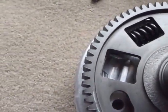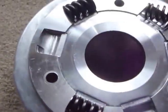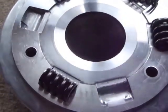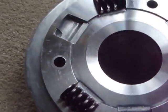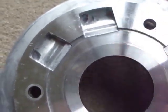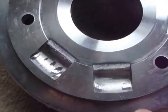The problem I'm finding is closely related to what was wrong in the Suzuki SV-1000s and DL-1000s, which I've repaired and modified hundreds of to date. But the big problem is this is only a low torque engine basket and you can see that the springs have started to eat into the aluminium. This basket's only done 5,000 miles so you can see there's a problem.